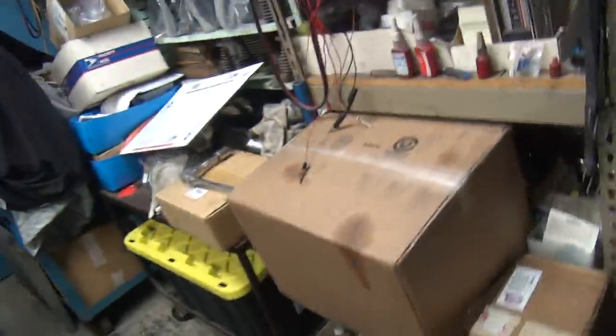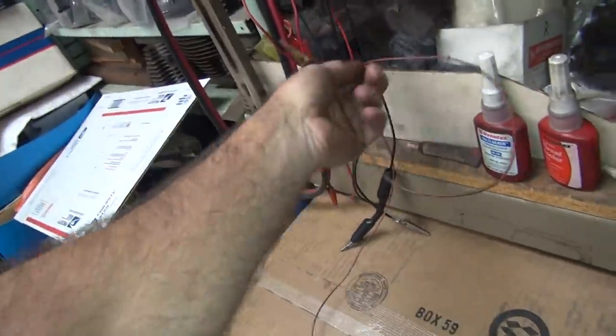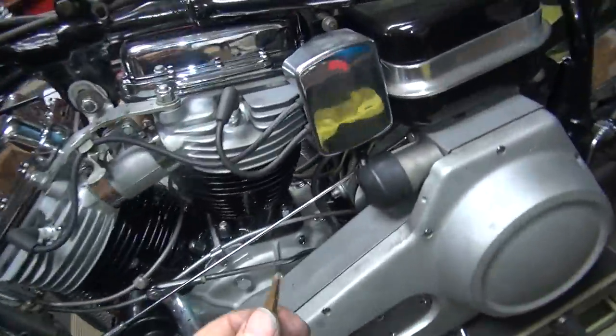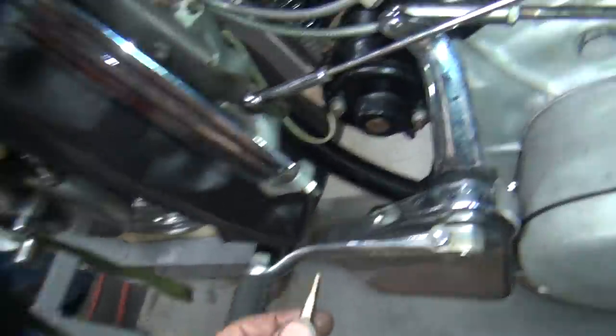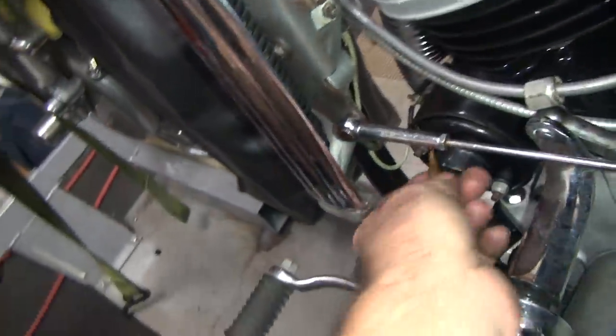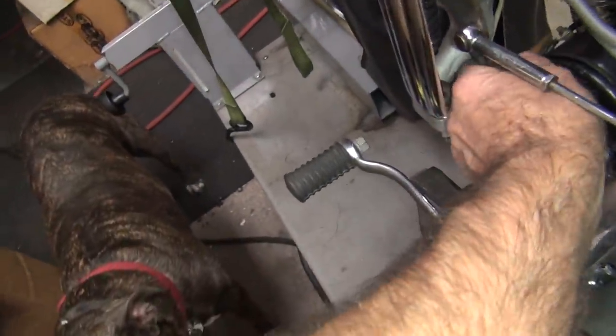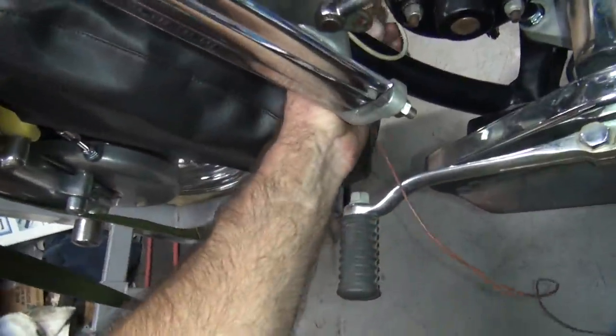So what we've got to do is polarize it and see if that takes care of the issue. Fumes aren't too bad in here. We've been running it for probably 10 minutes. Okay, so to polarize, you have to go to the armature terminal, which should be the red one. Need to get in here somehow. Hook that up down there. How long is this cable? It's not long enough to go around, I don't think.